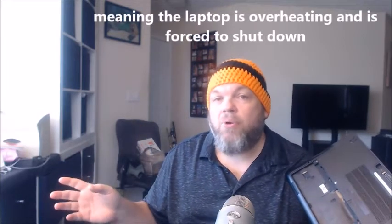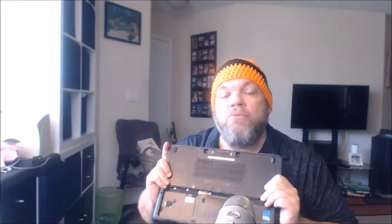If your laptop powers off and you let it wait a while and then you're able to turn it back on, it could be that your fan has gone bad. If you're a little technical, you can go in and replace the fan — the part is cheap and it's not as difficult as you think. There are tutorials on YouTube. But what you can do temporarily or maybe even permanently is buy a laptop chiller — a fan you place your laptop on that connects via USB. The fans blow inside the laptop and keep it cool. I'd recommend spending a good 20 to 30 bucks on a quality one rather than a cheap five-dollar one.